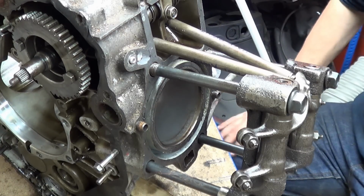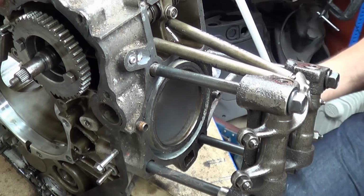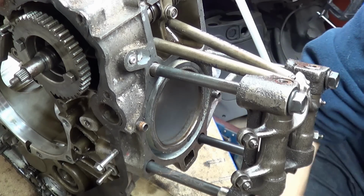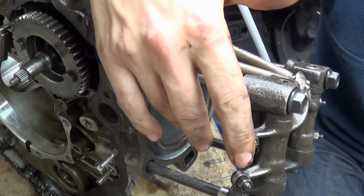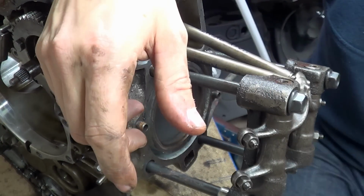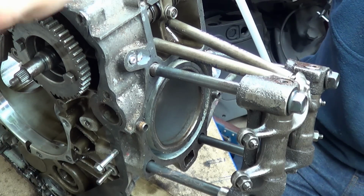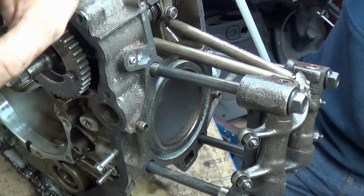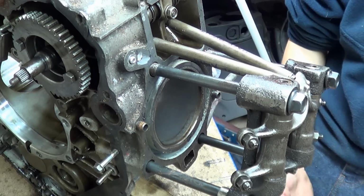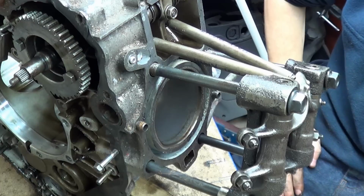So this is cylinder flushing. And it's a bit like a two-stroke in a sense. They use valve overlap to help increase the amount of fresh charge. The reason it increases fresh charge is because if there's, say, 5 or 10% of the gases in the cylinder that are then trapped when all the valves shut, if 5% of that is exhaust gas, then it's not fuel and air. So for your volume, you're straight away off the get-go seeing a 5% loss. So they realised that if they did this overlap thing, yes, you may expel a tiny bit of fuel and air out of the cylinder, but when all the valves close on the compression stroke, you have a full cylinder, a fresh charge.